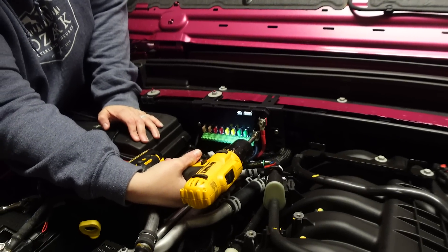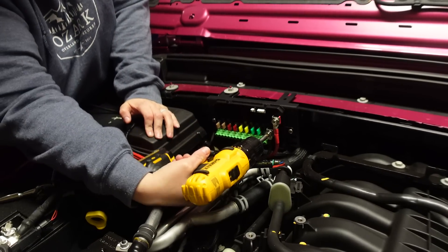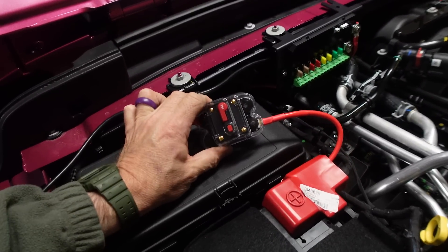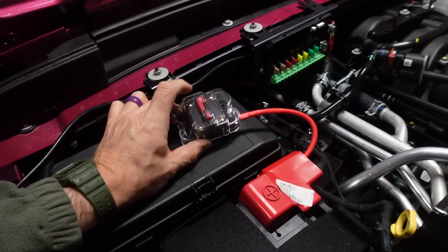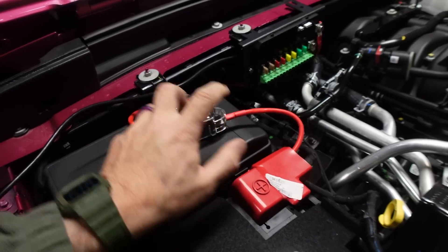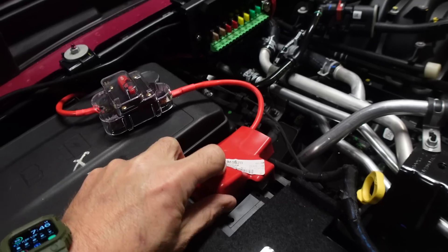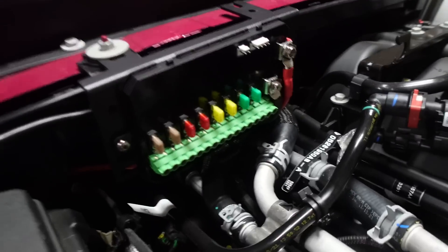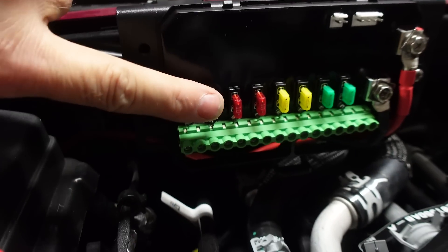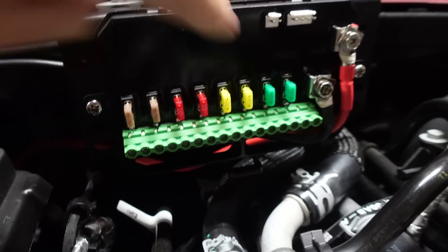Next, you just connect the positive and negative wires to the battery. They do provide a 60 amp inline fuse block, so if something were to happen you can easily check to see if the main fuse is blown. That goes inline before connecting to the battery. Each circuit also has its own fuses — rated at 5 amp, 10 amp, 20 amp, and 30 amp.